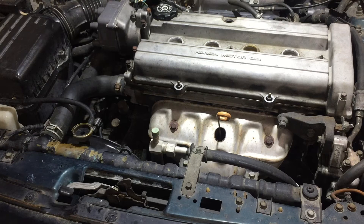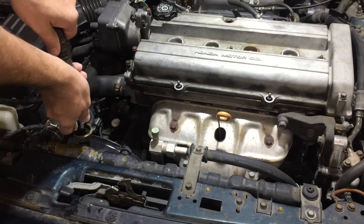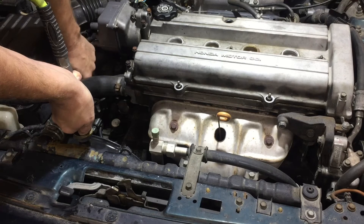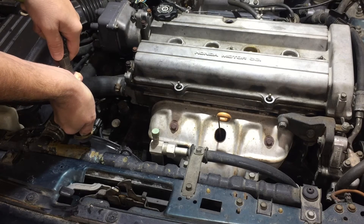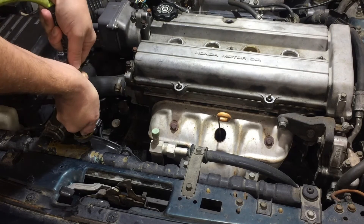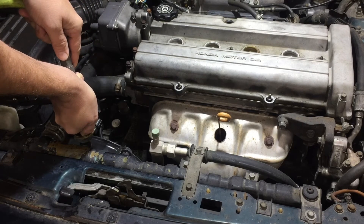I think it's the head gasket unfortunately, but let's see. I'm putting this down in here, pushing, and adding pressure. You can see the radiator hoses have expanded so it is holding pressure — it's leaking a little around the cap. But oh man — I've got a pretty good steady stream of water right there, and that's only at 12 pounds of pressure.